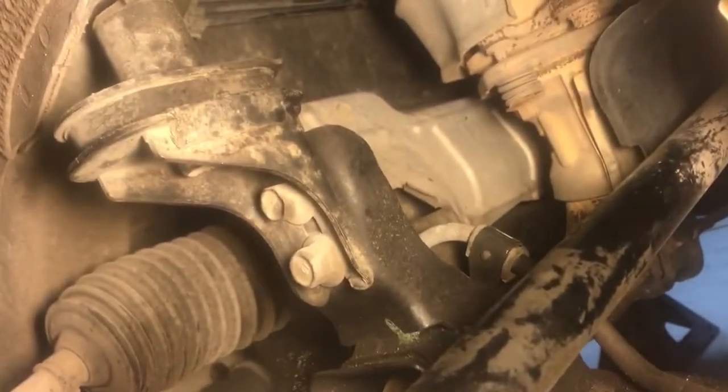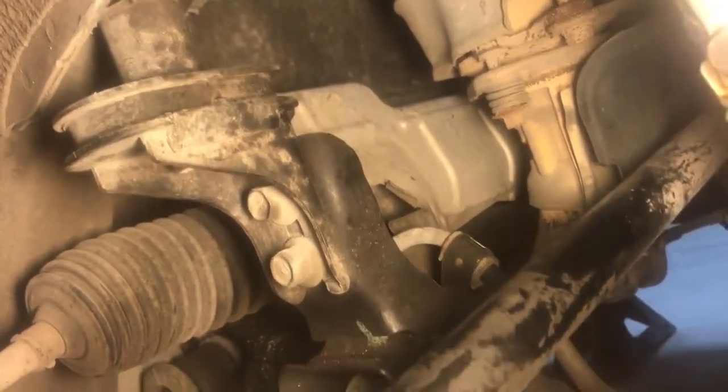And now, we're actually gonna need to take out that bolt right there. We're gonna need to drop that down because of this bracket. Forgot to do that yesterday. That bracket there. So we got that bolt out, loosened, and we need to get that one loosened. And then we should be good to go. Alright, so y'all remember that bolt there? We actually need to take that all the way out. Take it all the way out, and that should give us the clearance to remove that bolt.